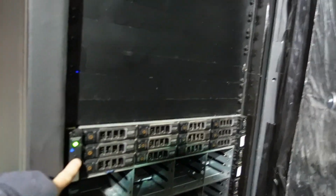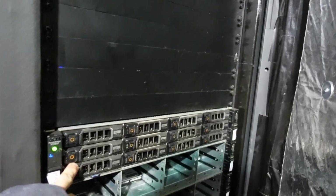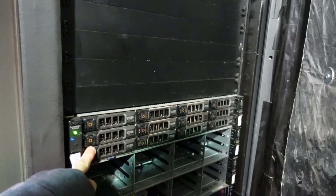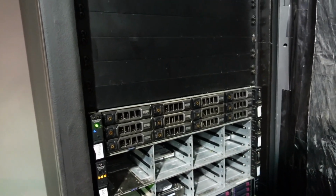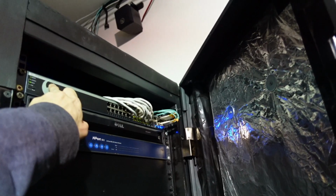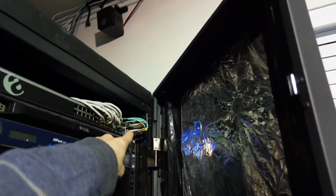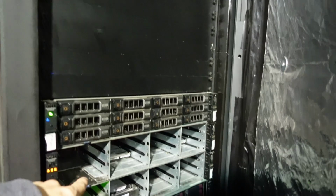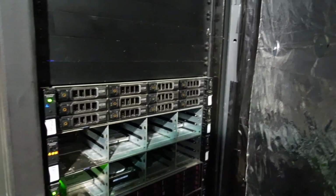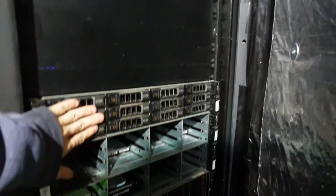There is no router. My server is my router. So this is a Gentoo based installation here, and it's running ISC DHCP server. So the ONT goes right back to the server, and this server is connected via fiber to this switch, and then my main rig is connected to fiber, and then drive wiper here that me and another developer do work on. It's got that 10 gigabit fiber, that way I can do the drive backups quickly to the server.